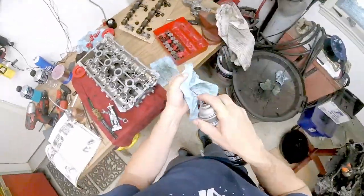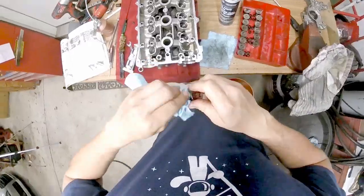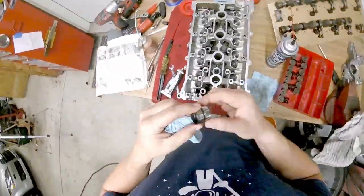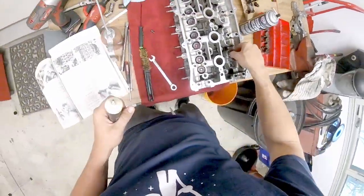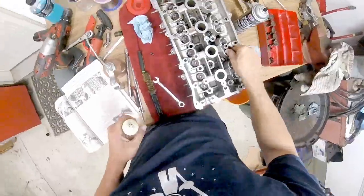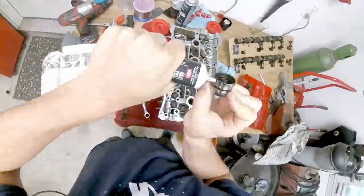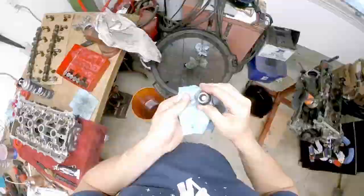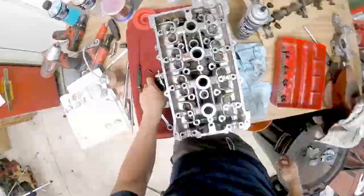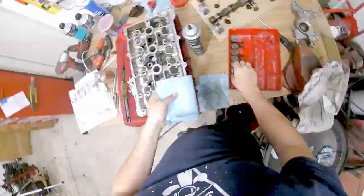Now it's finally time to install the hydraulic lifters. What we're going to do is just wipe down each one, check for any obvious scoring or damage, and then insert them back in the order that they came out. Use plenty of assembly lube here as this will be the last area to really get oil once you turn the motor on. A big thank you to Midwest Miata Parts who basically sponsored this video by donating all of the pieces going back into this motor build for the Force raffle car. If you're interested, head over there or to Force's website — I'll have links in the description.